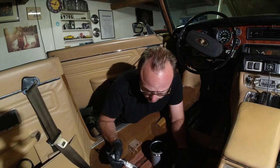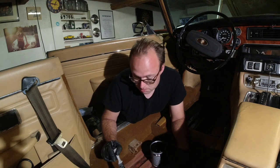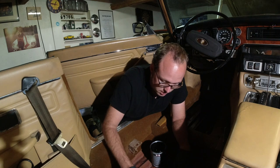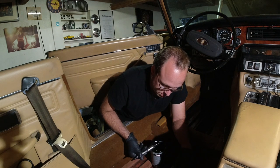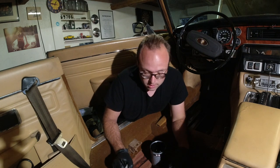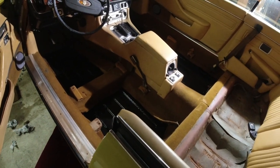I've also used it on outdoor furniture. All I've done is wire brush it by hand since we're doing interior, then used a scotch pad over it, vacuumed it out, wiped it clean with some thinner - that's it. I have just this part left to paint, then I'm going to let it dry probably a couple weeks before putting the interior back in. I'll put the seats back in last, but I did remove the rear seat so we can get to that glass.